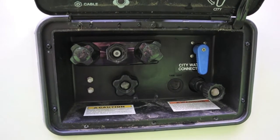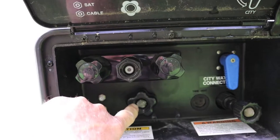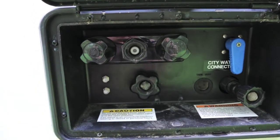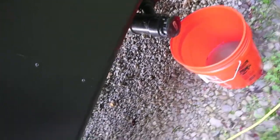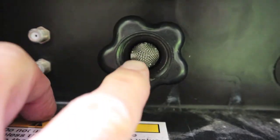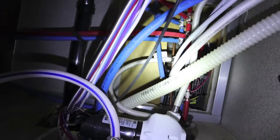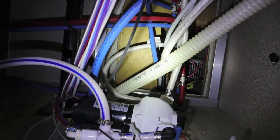This is my docking system. With mine — a 2019 Sprinter Limited by Keystone — there's the tank flush right here. You have to manually thread your hose onto it, turn it on at the water spigot and flush your tank. The last time I did it I was watching it go out — I have a transparent discharge on my RhinoFlex. Water started dripping out in a steady stream, and right where that belly is, water was streaming out. The leak was that bad. It's got a pretty good filter screen in it and you can see it's already collected some debris. I just swung it up and looked in with a flashlight and could immediately see water running down from that vertical blue hose big time, so I quickly shut it off and ended the black tank flush.